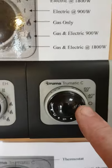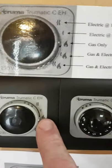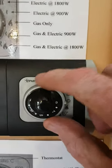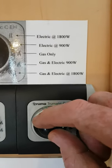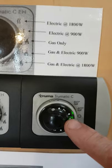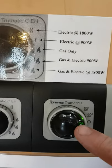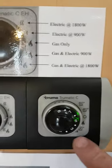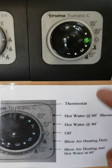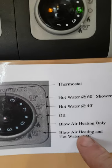The next knob: at zero the whole heater is off. We'll go back onto gas since we're not plugged in. The first setting is a small flame — that's heating the van — and the inner circle is the temperature you want. You can see a green light come on now: the green light indicates the heater is working okay. If you ever get a red light it means the gas is probably switched off. The first setting here is heating the van only.